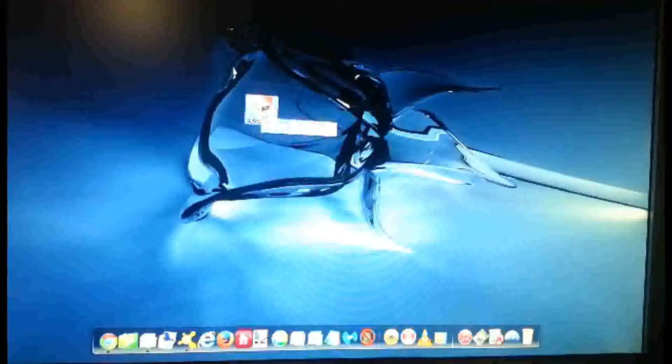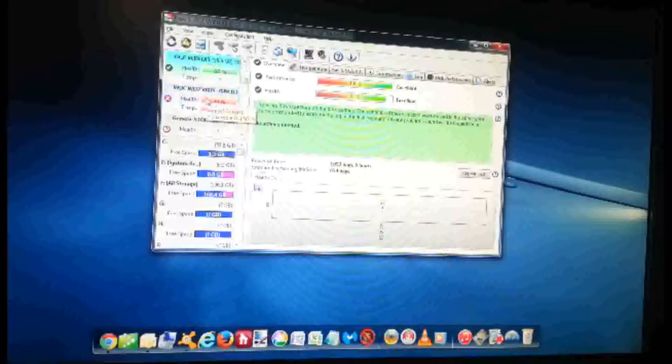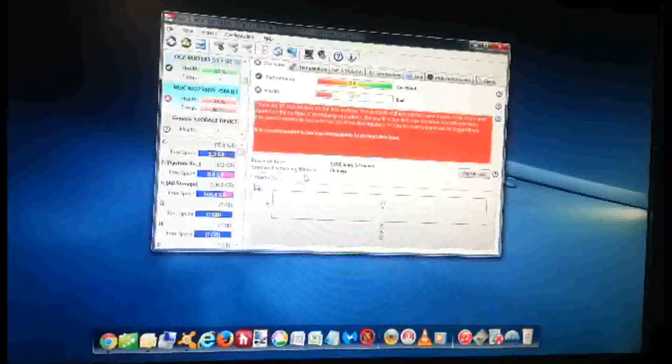Here's the icon for it. We're going to open it up and it's already reading data off the hard drive. We can see my Western Digital storage drive here at 100% health. Here's my SSD — this program is compatible with SSDs — showing 92% health with five bad sectors, but still a green surface so it's still good, with an estimated remaining lifetime of 654 days. And here's the hard drive on test: at 20% health, the background turns red, it recommends backing up the data immediately, and it's found 85 bad sectors. The estimated remaining lifetime is 20 days — this one is on the brink of death.